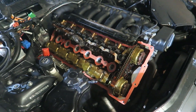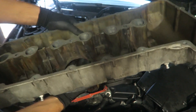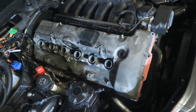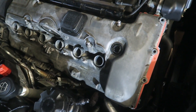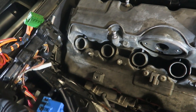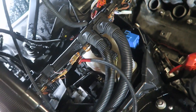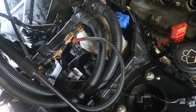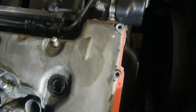It's time to reinstall the rocker cover after I've given it a good clean. The rocker cover is now reinstalled. The main thing to check for when reinstalling the rocker cover is not to pinch anything between the rocker cover and the gaskets, like any cables. As you can see, we have all of the cables and electrical connectors well out of the way — I would advise doing that just to prevent trapping anything in between the rocker cover and the gasket. Everything appears to be seated okay.